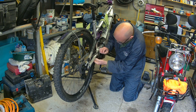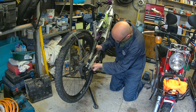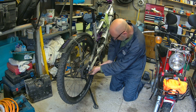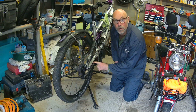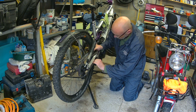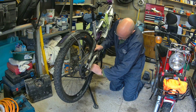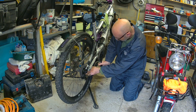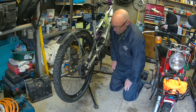So let's have a look at it. I guess you've got to hold the rear wheel — yeah — and then just push the pinning. If you're going to do the belt bit, hold the rear wheel to stop it turning, pull it down, and then once you've pulled the belt down just hold a couple of spokes and you can wiggle the holding-down pin in.